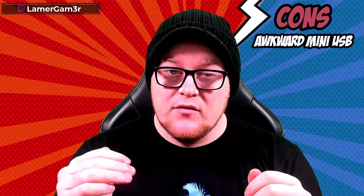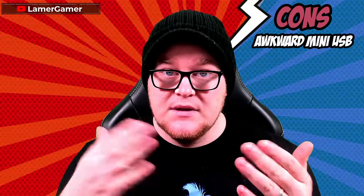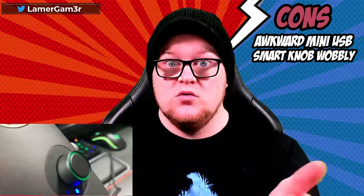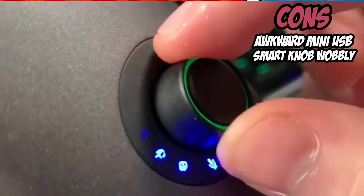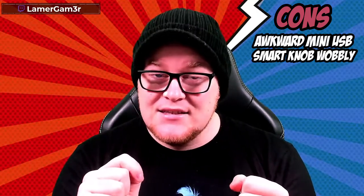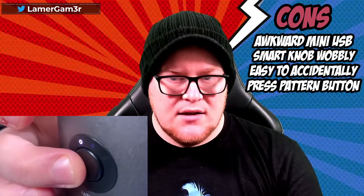Some other things Blue could do better are the buttons on the actual microphone and how the user interacts with them. On the speaking side where you can see the voice meter going up and down, the button can actually wobble a little bit. When you're pressing buttons while talking, it can sometimes jump into the gain setting. It's just a little bit of a wobbly spindle on the knob. On the back, for changing the pickup patterns — whether omni mode or stereo mode — you can easily accidentally press that button. The problem is you can't actually see what mode it's in, and if you're moving it around on the desk, it's quite easy to mess up your sound settings and end up in a completely different pickup pattern.